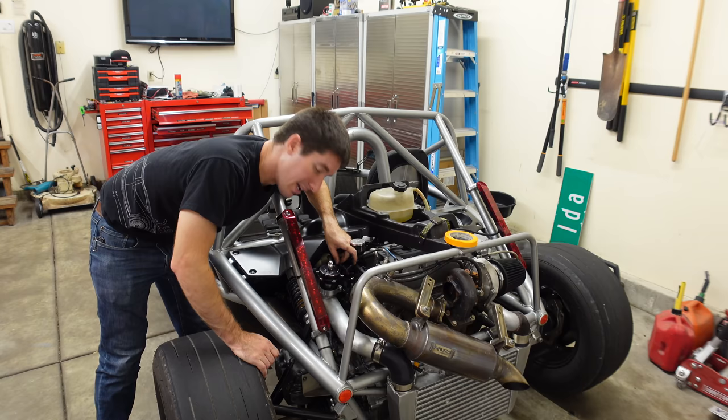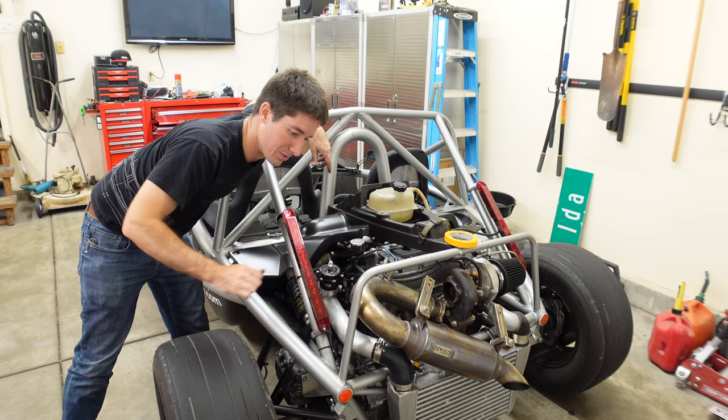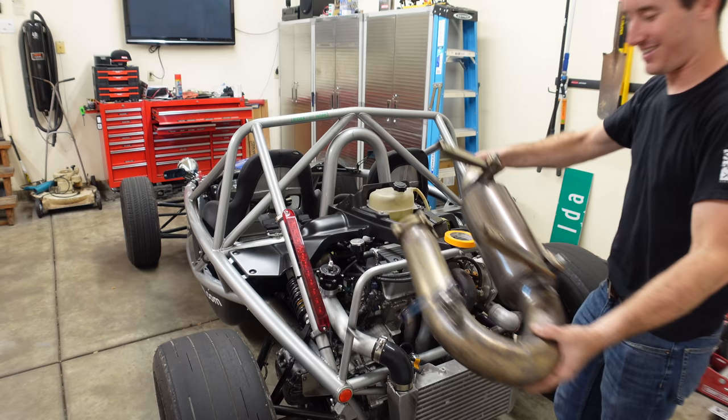I found another cool problem. We had no boost control — we were leaving on 10 pounds. Just keeps getting better and better. Because of the way this was wired before, I didn't have the weather pack terminal, so I didn't have a way to fix the wiring. There's the wide band. The exhaust is off. Now it looks like we can finally get to the turbo and fight this battle.